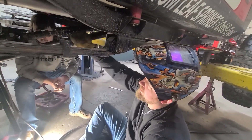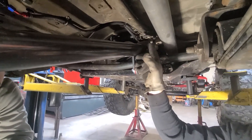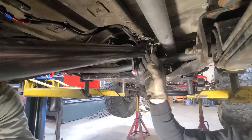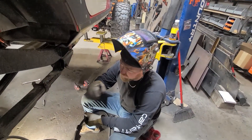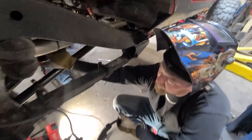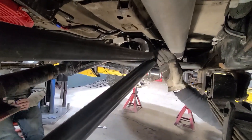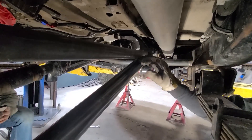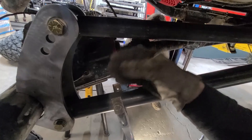This kit has a piece of 2-inch DOM for the bottom length. We're going to go from the bushing mount on this side all the way up to our Orbiti, and we'll weld this one straight to the Orbiti sleeve. Once this one's tacked in place real good so it won't move, we'll cut the upper to come from here to where it meets the sleeve. With the bottom tacked in place, we got the upper bar trimmed and fitted. It's going to sit flush on that DOM tube there, but up here it's going to be a long cut depending on your length and angles — we find it easiest to do it with a grinder. I'll tack all this up, tack all that end up, pull this out, weld it on the bench. We'll probably add a gusset in the middle and finish weld everything up and that should be it.